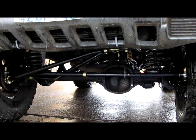Well, what it ended up being was the joints actually got dried out as far as lube after the pressure wash. And so when I put some input in to the left on the steering wheel, it was like it was kind of bound up, you know, there was no lube, so it didn't want to turn, and then all of a sudden it would catch. But by that time I had put a lot of input into the steering wheel, so it swerved one way, then I tried to come back the other way to correct it, and it swerved the other way because the joints were catching and then releasing and then catching and then releasing, and it was really bad, and I was worried about it. But then I said, you know what, let's just try lubing it up.